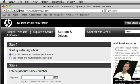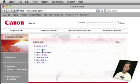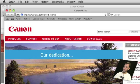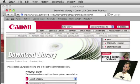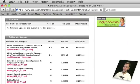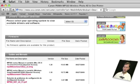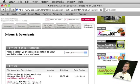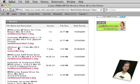Usually it involves searching for the product by number. Here is the Canon website for doing the same thing — you have to locate your area first, and then once you are in there you can look for the Download section under Consumer and select different categories until you get to your printer and find the drivers. Here I am at a specific printer page on the Canon website. Sometimes it takes some detective work — for instance, if I look I can find only documents listed, but if I look closely I can see it asks me to select my operating system. I select Mac OS and now I have all Mac drivers and documents, including pieces of software and things for the scanning part of this multifunction printer, as well as the printer drivers themselves.